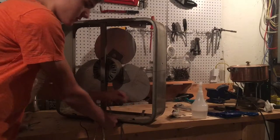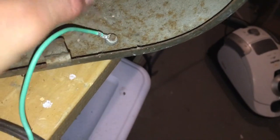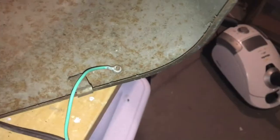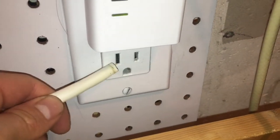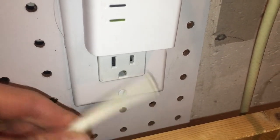The ground wire in the meantime goes here. You can see there's one of these bolts for the feet — I can pull up that bolt and then I can put the ground wire around it. This will ground the case without having to put any screws into the case or alter the design, and it will run along the bottom completely free from interfering with the blades. Now unfortunately since somebody chopped off the prongs, I have no way of identifying which is the positive and negative. I'm hoping when I open up the conduit box I can check to see which is which. I believe the hot wire is the smaller one, that one's the neutral, and this is the ground — the real neutral. So that's all of them.